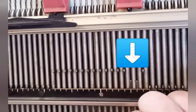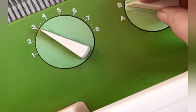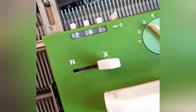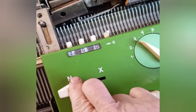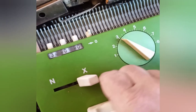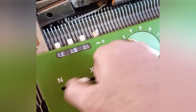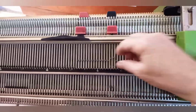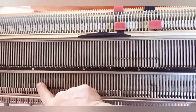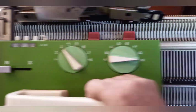So the failure of the pushers to move freely won't be an issue for EX. However, BX and AX will be issues. BX is the setting we use for short rowing; it's also used for fair isle. You always have to go back to N to rotate the letter dial. FX uses pushers, and usually AX uses pushers. Let's pretend-knit a few rows in N. Even though these pushers really should be in the rail, it's not a big deal because on N the lock just ignores the pushers.